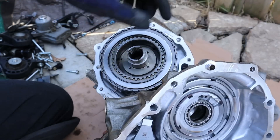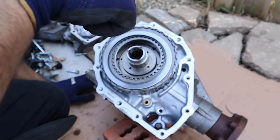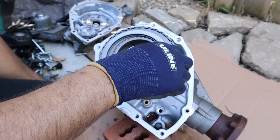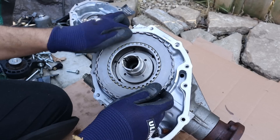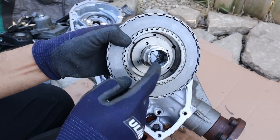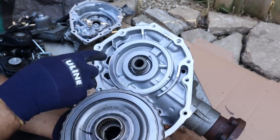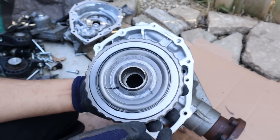Inside of this casing here there is a roller bearing upon which this shaft rotates. Now this shaft here is splined internally and goes to the axle that powers the rear right side wheel. You'll see that there's also a thrust bearing over here. Now this entire thing here is the clutch pack. Here you can see the piece that's splined to go to the axle — it's marked 2019 because this was a 2020 model. This here is the output coming from the differential, and this here is the input to the clutch pack.